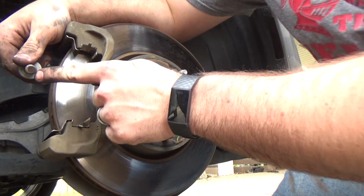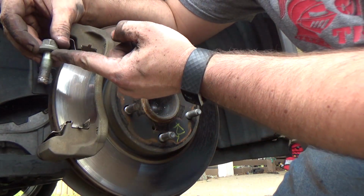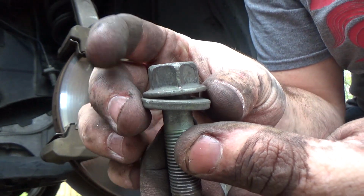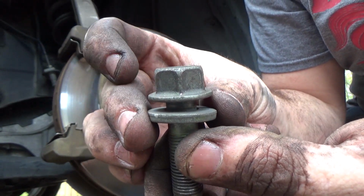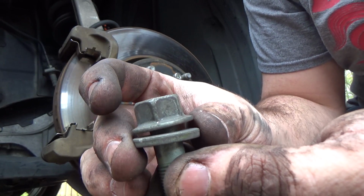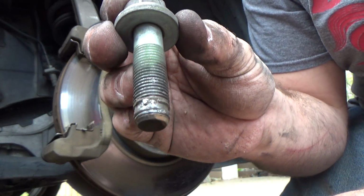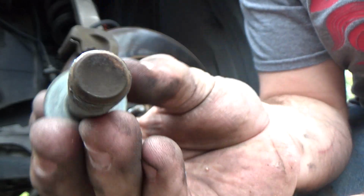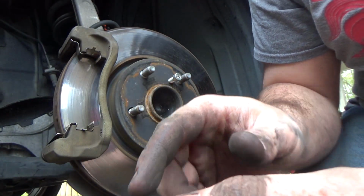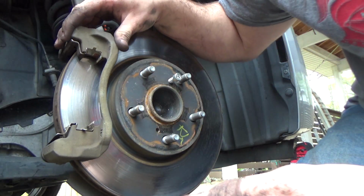And that's because this bolt was in, but it wasn't tightened. So essentially, if the washer is the flange, it was right here, so it wasn't tightened all the way down. So just because you hit torque doesn't mean something is seated. And the reason that it torqued and did not seat is because someone cross-threaded it. And now this job just got a whole lot harder because we need to check the status of the threads that are inside this caliper mounting bracket.